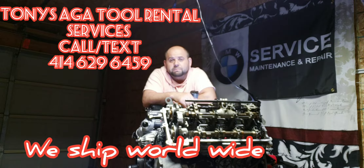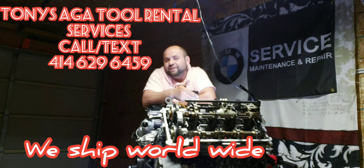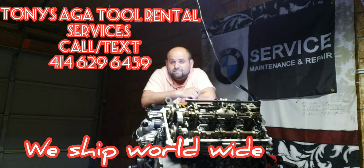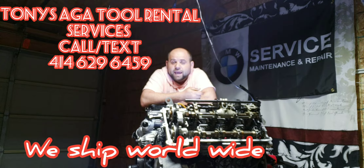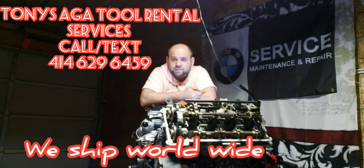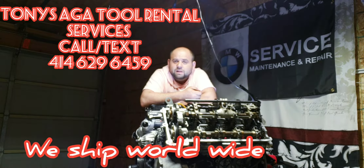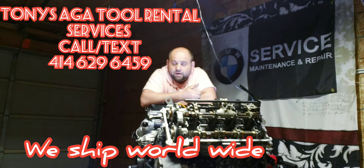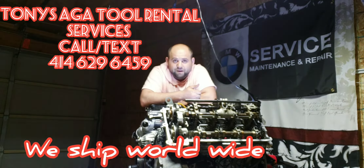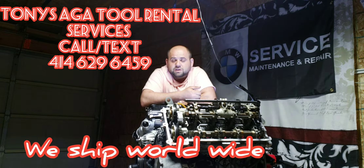These cars are relatively cheap nowadays — you can get a decent one for $5,500 to $6,500. If you do buy one, it's 2019, and somebody tells you they've done the valve job, ask for pictures. A lot of people get fooled by someone switching to a thicker oil — it'll stop the car smoking for a little bit, but it'll start smoking again in a matter of hours or days. A lot of sellers use thicker oil when they sell because they don't want to do this job.